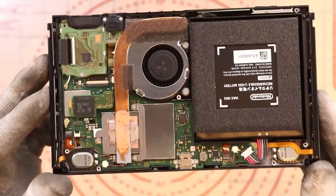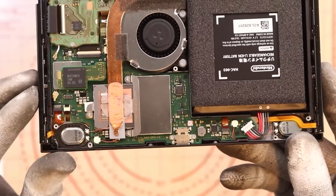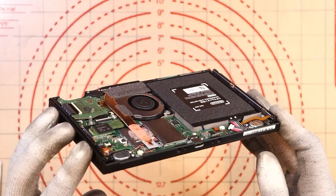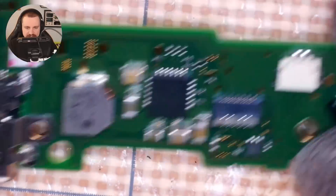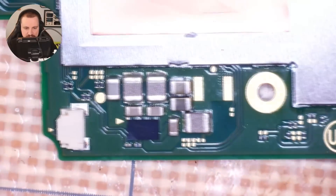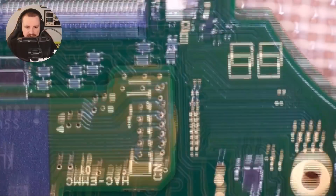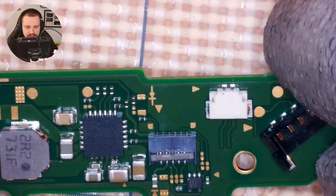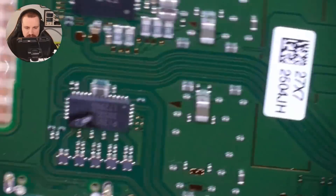Just as I expected, it has jumped up to 470 milliamps but it's not fast charging, so I don't think the Switch is initializing — it's charging the battery but not turning on. This is a known good working battery, and again we don't bump up to fast charging. I'm hopeful the screen and digitizer are actually okay. On the inside, it is just as clean as a whistle. The water damage indicator is still intact. The board itself looks relatively clean — no big explosions around BQ. Putting the board over — makes complete and utter sense. The seller stated he put it in the docking station and then it didn't work. My advice: get rid of that docking station.